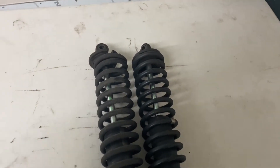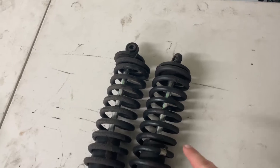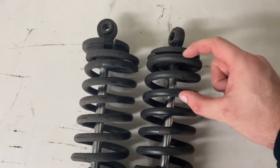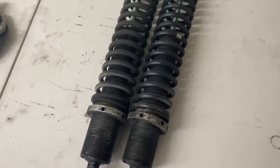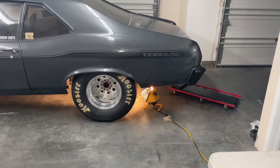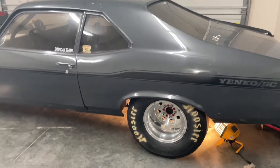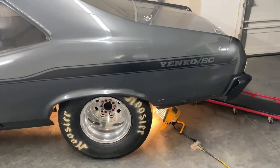Got it all finished up — new shocks are installed. Here are the old ones, and these have definitely seen better days. When these were on the car at ride height there was only about two and a half inches of compression stroke showing, and there are no adjustments on these — I don't even know if there's oil left in them. There was no compression at all; you could press down on the back of the car and hear it bottoming out. I think that's what was causing a lot of my issues last year — the car would launch, squat, bottom out, and just put the front end back down, not making for smooth launches at all.